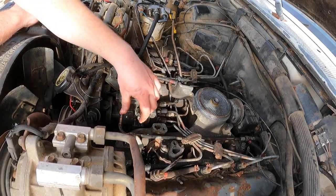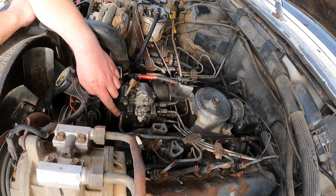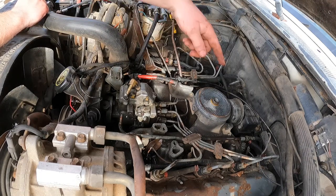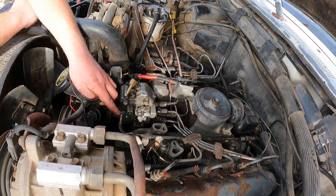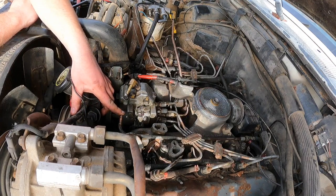Well, something is definitely occurring. Fuel is coming out of the return line. I wonder if this fuel filter's clogged. It's like fuel is pressurized up here, then going through the whole return manifold, and then fuel is running out of right here where it returns. Well, yesterday we had it coming out of the fitting off of the filter. I've got a new filter, we can throw that part in. Let me hold my finger over this. Ready? Yes. Very strange. Granted, no idea what I'm doing.